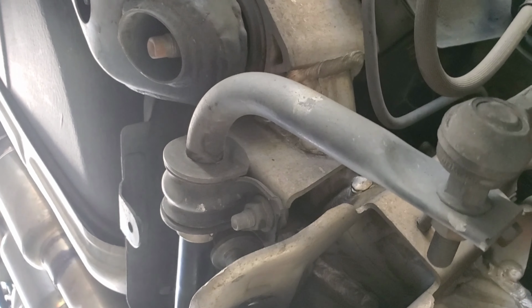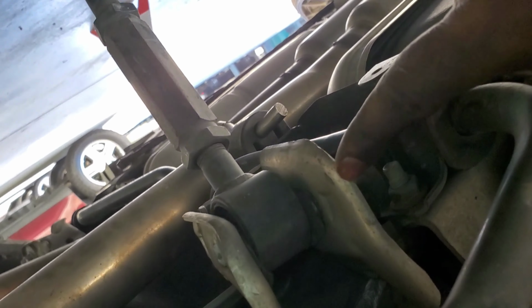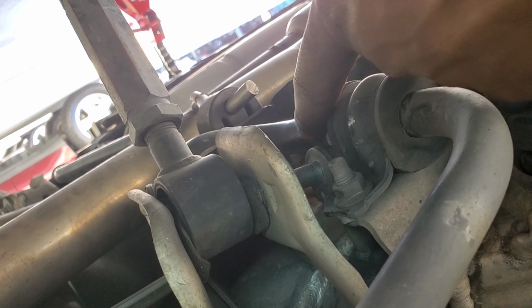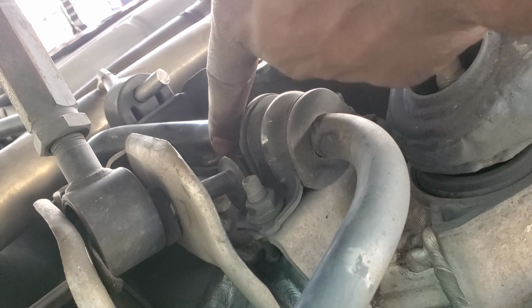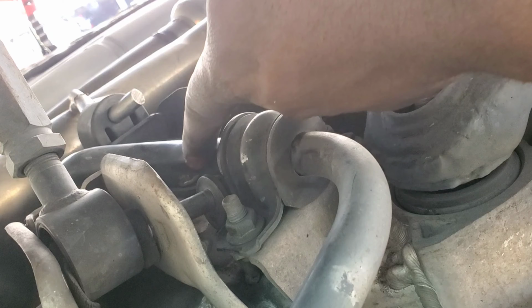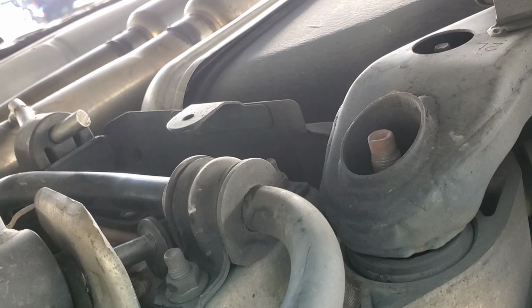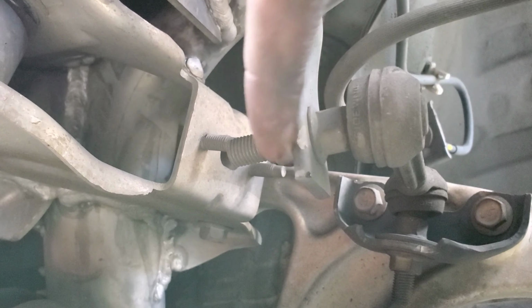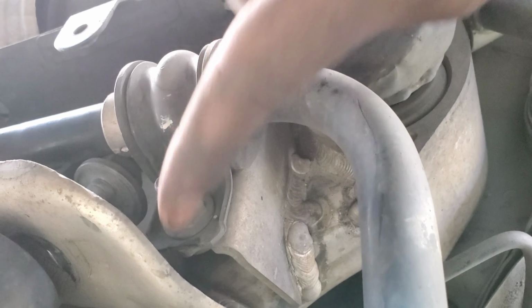But essentially, the sway arm comes down here, goes down and around to the back side of the camber arm. The camber arm washer is yoked, which means it's longer on one side than the other side. I thought I could just slide it right past that sway arm, but looks like I can't. So what I'm gonna do now is just pull off the sway bar. I'm just gonna pull off this nut here and then the two mounting nuts on top, lower it, and then pull that bolt out for the rear camber arm to come out. Should be pretty easy.